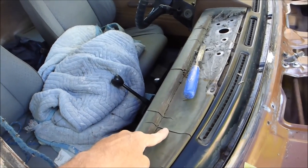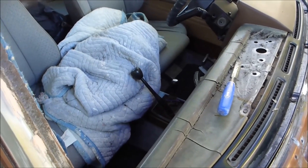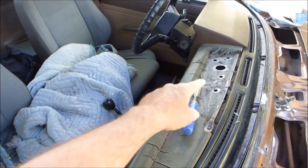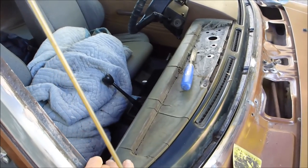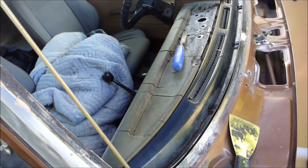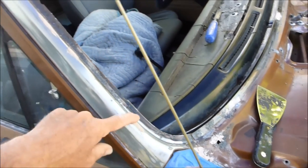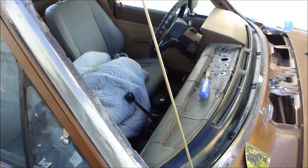Down on the dash — since the dash is all split and horrible, I'm going to cut it and try to replace it with wood as much as possible. I could go a full wood dash but I really don't want that big of a woodwork project, so I think I'm just going to fill this area in with wood and do a cover over it. I'll still paint this area which gets exposed to the sun and you can't get to it once you put the windshield in. Once I prep all that area out, I'll drop the windshield back in and hopefully it'll stop the leaking issues.